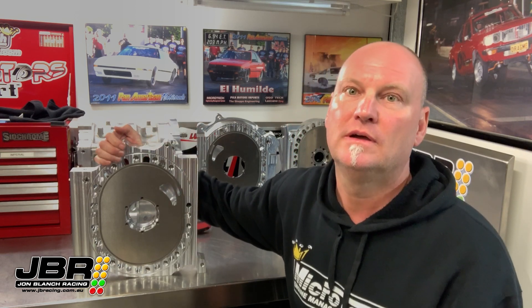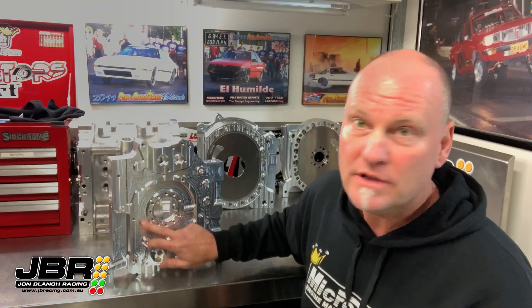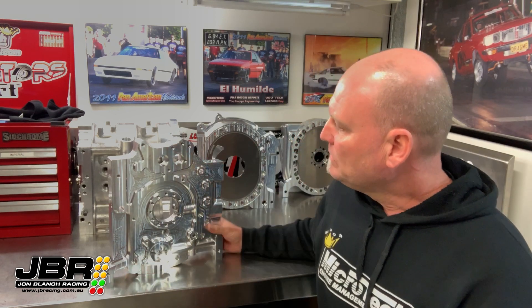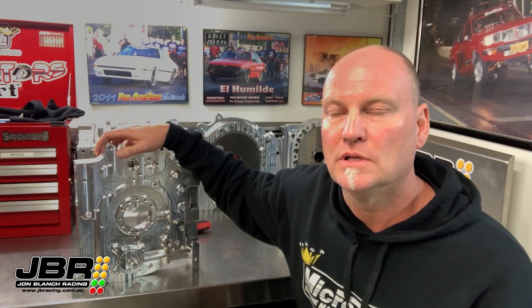The plates are modelled off the Cosmo-style Mazda plate with a large intake port runner, and they've been beefed up substantially in the areas prone to cracking on the factory plates. The outside dimensions are all identical to the Mazda plate, so all the bolt holes for your intake manifold, timing cover, oil pump, water pump, bell housing, etc., all bolt up just like on a standard plate. The aluminium is 7000-series — very similar strength properties to steel but obviously a lightweight alloy. The 7000-series is a lot harder and more expensive than 6000-series; it costs more to machine due to higher tool wear, but being a much harder material there are quite a few advantages when using it in an engine plate, which I'll talk about more later.